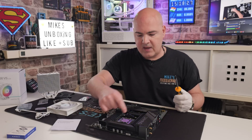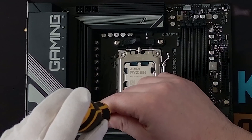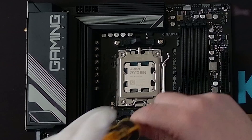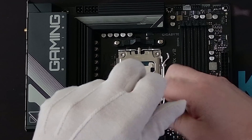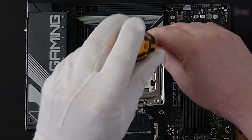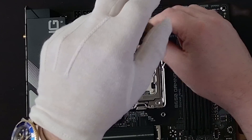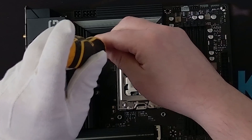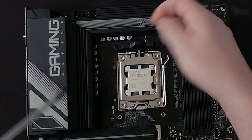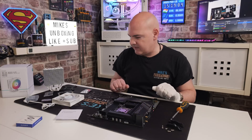The first thing you're going to want to do is remove the stock-fitted AMD brackets, which are plastic. There are four screws holding those on, so just get a PH2 screwdriver — or just a cross-headed screwdriver — and remove the screws, then remove the plastic parts. Keep these safe; put them in your motherboard box or bag just in case you ever need to reuse them. They might be a little tight in some instances, but should come off relatively easily. So four screws and two plastic brackets removed — now we can move on to the AMD fittings bag.